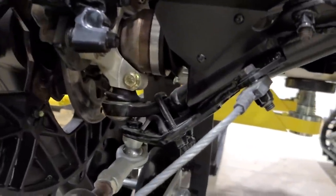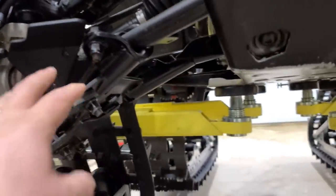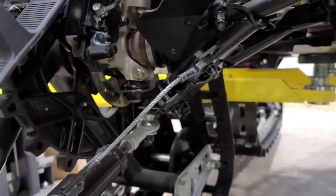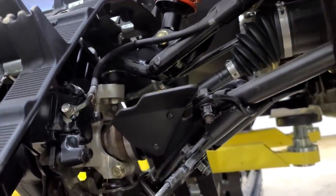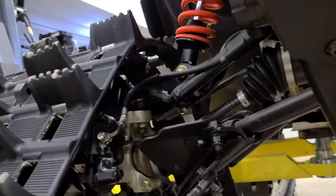You're basically just bolting these anti-rotation brackets onto your lower A-arms. So really, the Backcountry tracks are a tiny bit different than, say, the Apache 360s, but they are very similar. You got a U-bolt there with two nuts, and then you got two nuts on each one of the lower A-arms. Undo those four, boom. I already have the lug nuts off, the whole thing comes off.